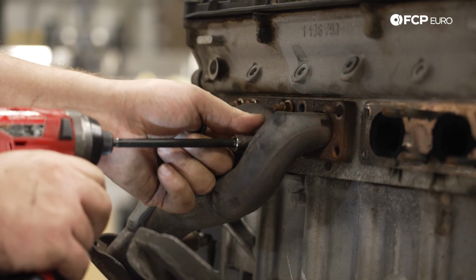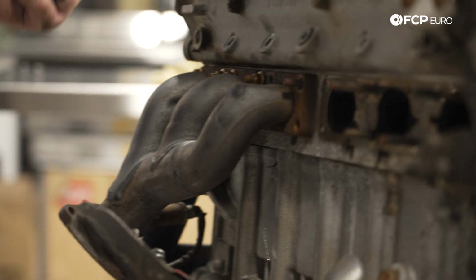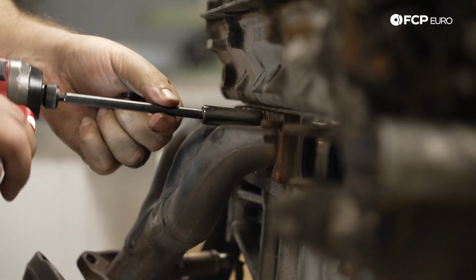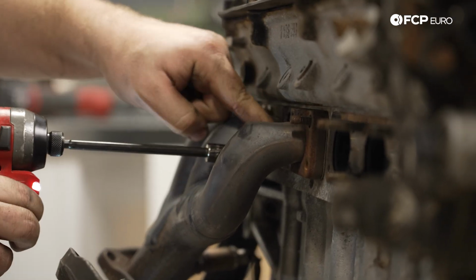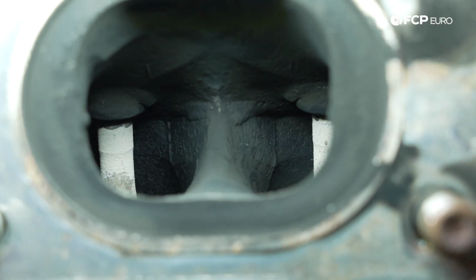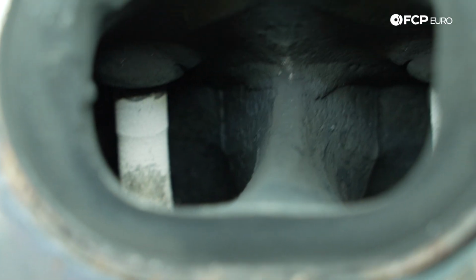All right, while Steven's pulling off the exhaust manifold for bank 2, we're going to see if it dropped a valve on the exhaust side. If the valve is there, the mystery thickens. The valve stem is still there, so it didn't drop a valve. Doesn't mean that the valves didn't kiss some piston.